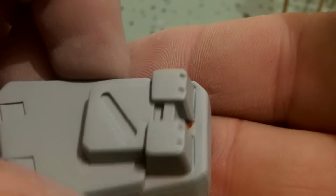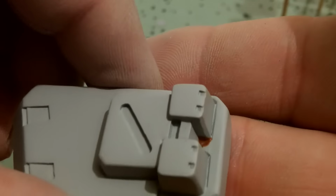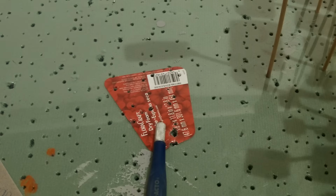And once that dries, I'm going to go over it real lightly with a sanding sponge, and it'll be ready to go. And the nice thing about the Bondo spot putty is if it's small enough, you can paint right on top of it. You don't need to prime it. So I probably won't even reprime this piece, because this has already been buffed and ready to go.